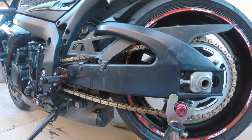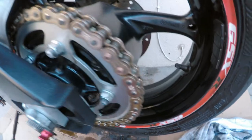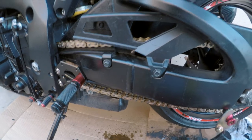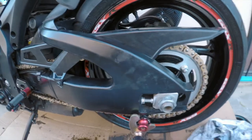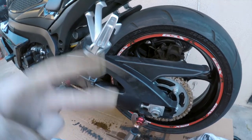During the lube process it gives the chain a gold-orange color — make sure you get it all nice and waxed. I'm going to wait a little bit till it dries and then wipe off any extra wax with a rag. That's pretty much it, that's how you do your chain maintenance. I'll give it about 200 to 300 miles before you clean it again — keep an eye on it. Let me know in the comments if you have any questions or concerns, give it a thumbs up if you liked the video, subscribe if you're new, and I'll catch you on the next one.